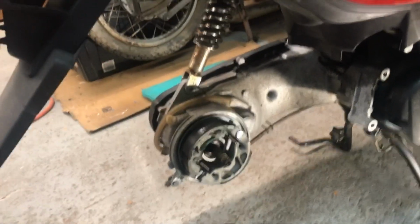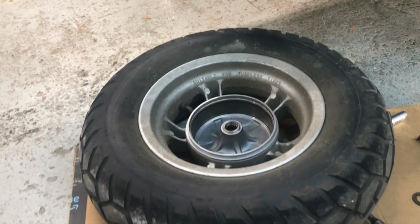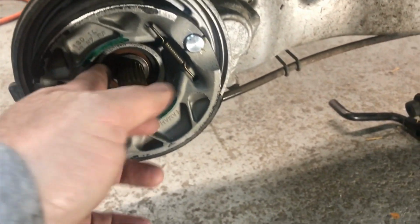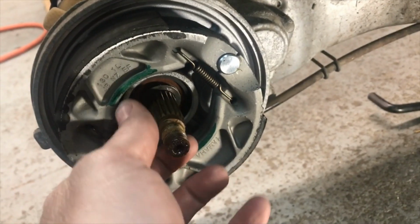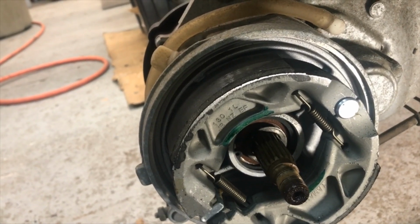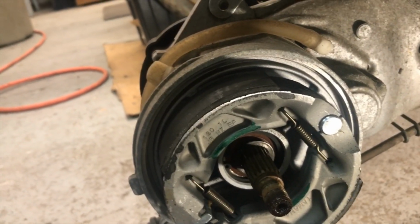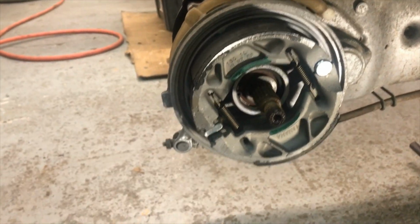The tire just came right off of that spline. I figured I would add this to the video because you see something important goes on here. See that little piece right there? A little washer. Not really a washer, it's a spacer, and it's a surface that helps this to slide, and it goes right there, so it maintains the clearance, but it's a hard part so it doesn't wear and dig in. That's important. Brakes look okay. I'm not much on brakes, but so here we go.